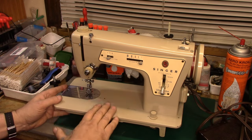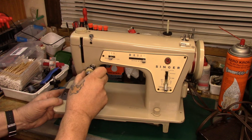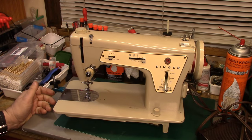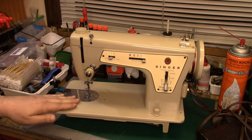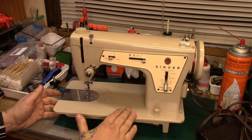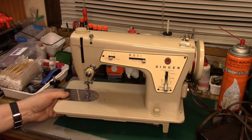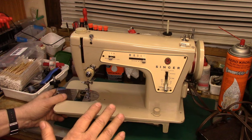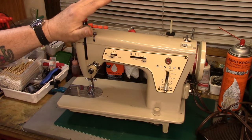The only fault I could find on this machine when I visited her at her home was the indicator plate, which also has the release mechanism for the upper thread tension. That was broken, and it had been a replacement part - the color wasn't right. We looked at her other machine, which was in perfect condition, so I swapped out those parts. There wasn't much else that needed to be done except check it, test it, give it a good cleaning, and lubrication. There were a couple of things I wanted to take apart that I wasn't comfortable doing at her dining room table, so we agreed I would bring it back here to the shop.